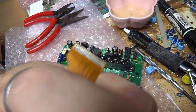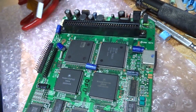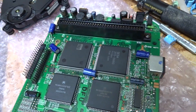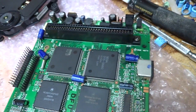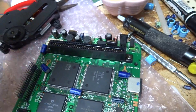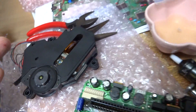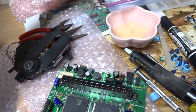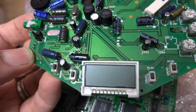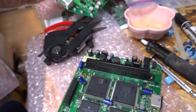Here you can see the strap — I've just scuffed it up a little bit to make better contact when putting it back in, because it was really shiny. Unfortunately, sometimes those shiny contact surfaces don't make good contact with the pins. Scuff it up and put it back in and it's usually good to go. All the capacitors are in and changed out. The remaining possibilities are a dead laser, pots turned out of adjustment, or something shorted — possibly causing the display not to work.